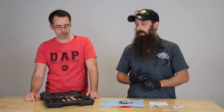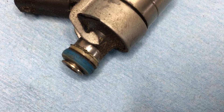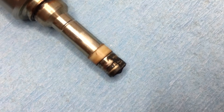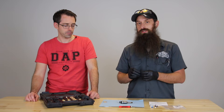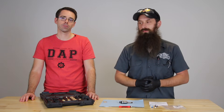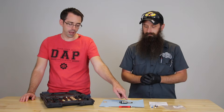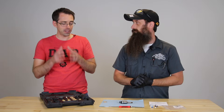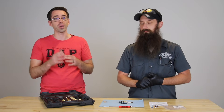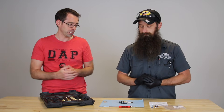Some of these tools are to remove the injector, to install the injector. I've used this kit a lot and not used most of the things in it. The outer seal is actually really easy, very much like all the other fuel injectors. The one that goes into the cylinder head — this nylon seal stretches over and then you have to shrink it back down using these dies. It's not as simple as just putting it on and jamming it into the injector port. You need to form it and then install it. That injector seal is so important because it's in the cylinder under a tremendous amount of pressure being direct injection, so you have to make sure you have a good seal there. Otherwise you could have combustion chamber leakage coming out of the injector.